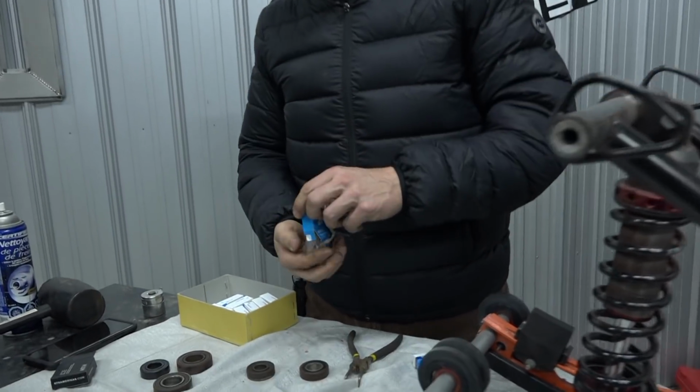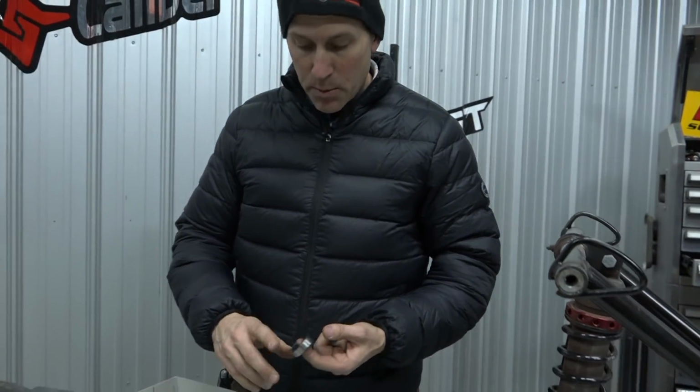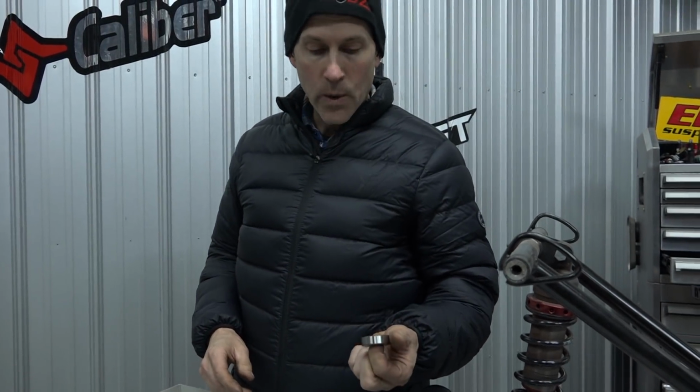Like I said, they don't have black ice and everything. These are the other NTN bearings. These are the snowmobile bearings with the low weight or low temp grease. You got to make sure you use low temp grease in your bearings. That's why you don't get the general service jobber kind of bearings for your sled. You got to make sure they're low temp, especially when you're running something like an Elan with a whole lot of bogey wheels. I think there's 12 bogey wheels on that Elan.